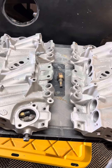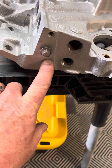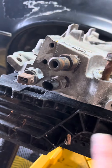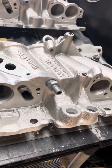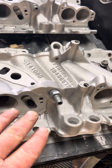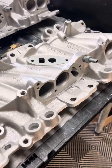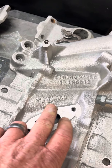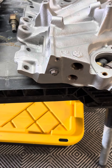When we go up to 89, they remove the ninth cold start injector. As you can see, this boss right here does not have the hole for the ninth cold start injector switch. Now, some people think that the manifold itself doesn't have the port — it does in fact have the port right there. It's just that when you put a non-ninth injector runner on here, it basically seals this port up and the gasket seals it up. There's also an additional stamping on this one, but I have one in the shed with the same stamping that has the ninth injector switch boss, so I'm not sure if that stamping is relevant.